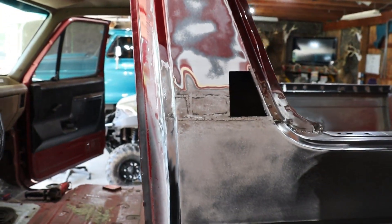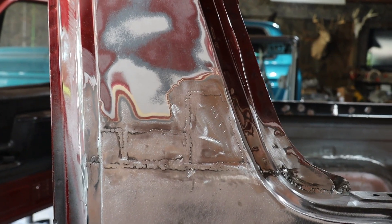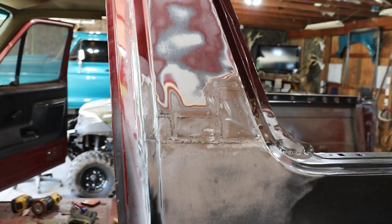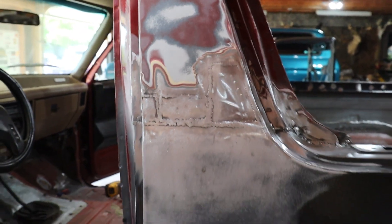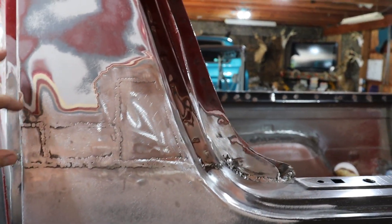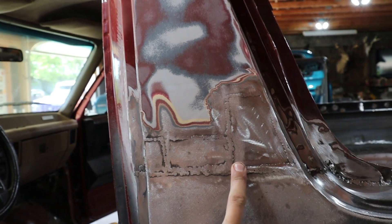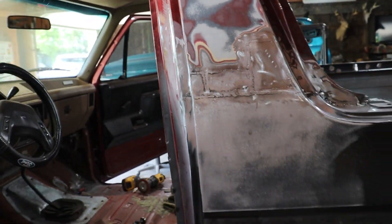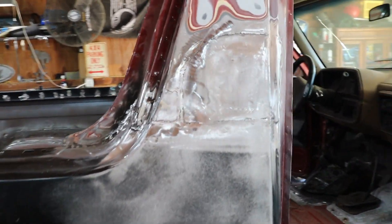I'll suck it up and get it done because I don't feel like fixing that in a couple years. That's finally done. I wish I would have known that here and up here were all rusted out, because I just wanted one whole patch all the way across. At first it was just here and here, then the more I ground, some pinholes showed up, and behind that was all rusted all the way up. I wish I could have done one whole patch for both sides but I didn't know that till I started. Oh well, we're ready for some Dura Glass so I can get some spray down there.